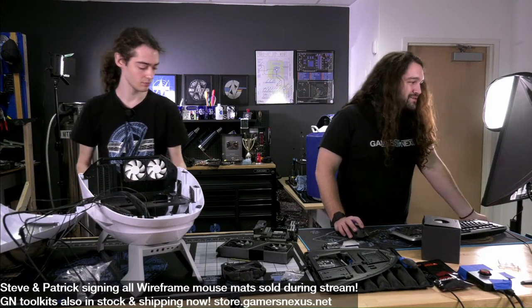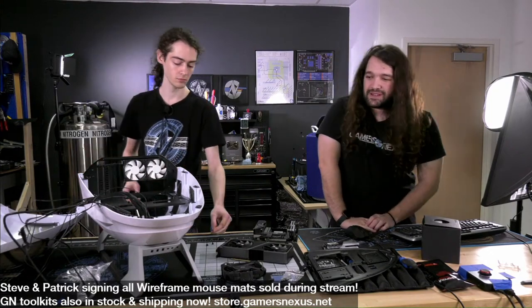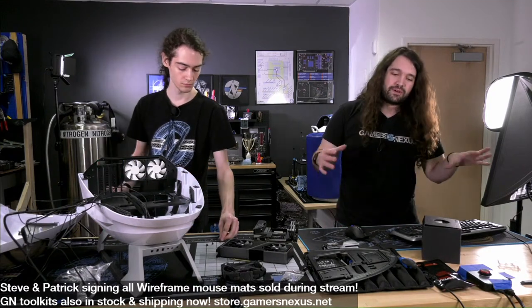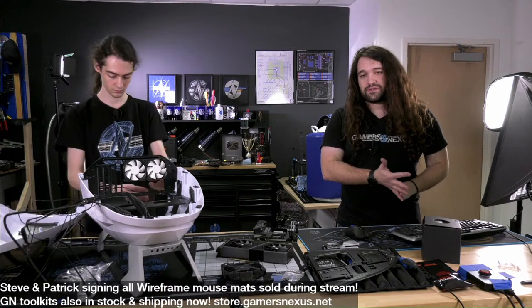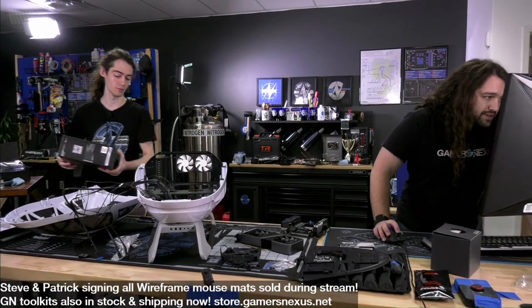Maramu sent RON25, thank you. So this case got me thinking if current case design is best for cooling and airflow, thoughts on this. So just in general, it always feels like it's hard for a case to really improve for design because it's kind of simple at the base level, but the optimal airflow layout for a case depends on the case itself. But we've seen situations where inverted or inverted and flipped orientations, like on the Raven RV02, are superior to a lot of standard designs. Doesn't mean they're always better, but depending on how long the case is and where your GPU might start blocking airflow, like from the bottom, for example, if the GPU, like on an SL600M, is interrupting airflow to the CPU, that's not great.